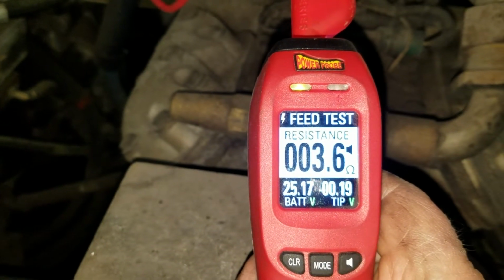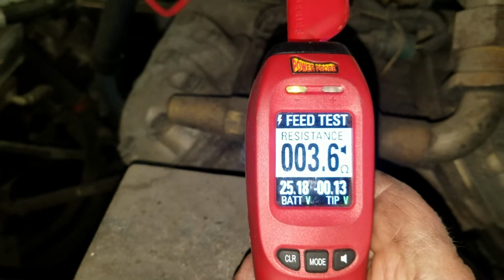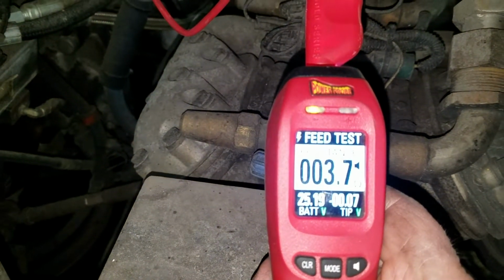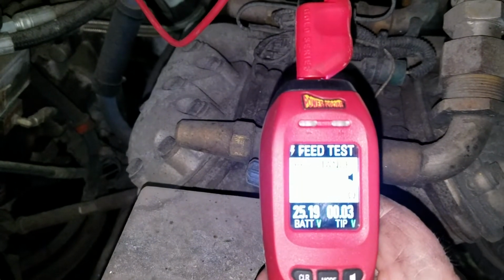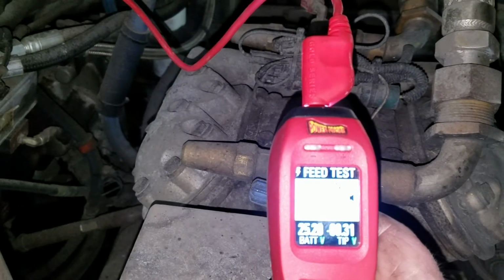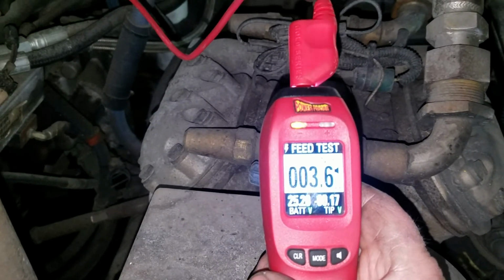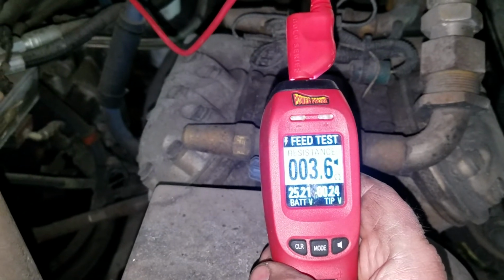Now if you notice, it's going 3.6, 3.7 ohms, and then it goes 9999. What's happening there is it's going open, okay? The resistance for these field windings is from 3 to 4 ohms, I believe. I'll have to double check the service manual, but I believe it's from 3 to 4 ohms. I'll put information in the description to verify that once I get some extra time.